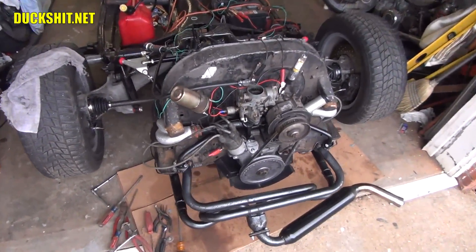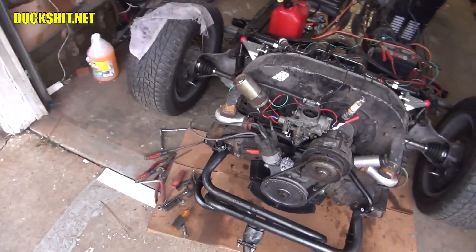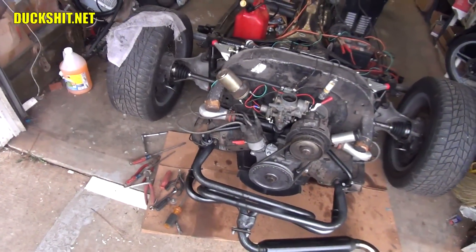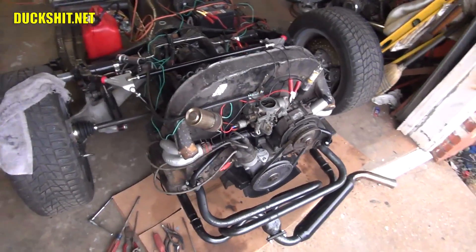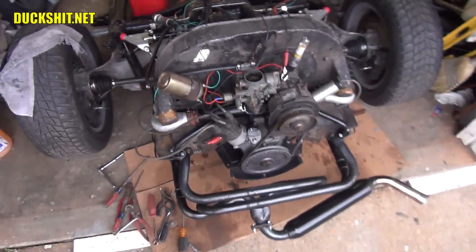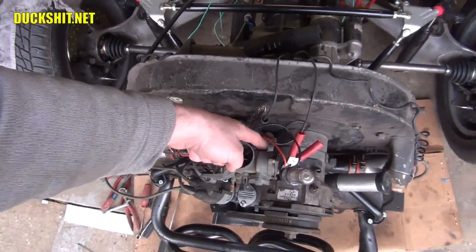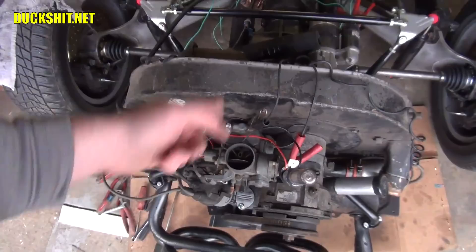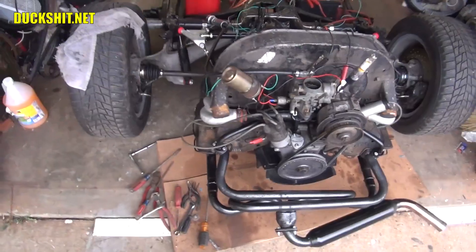I had a brand new one on here and it wasn't running all that well, so I replaced it with one I had sitting on a shelf. I cleaned it up, put it back together. Most of the carb jetting is the same as it was on the other one, but it runs a whole lot better - there was definitely something wrong with the other carburetor. People told me to take that idle jet and upgrade it. I had a 55 and upgraded it to a 65, but it didn't make all that much of a difference.